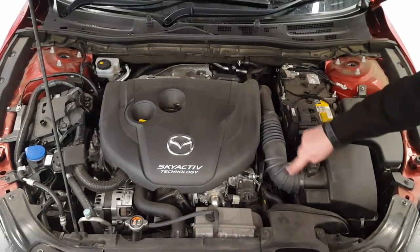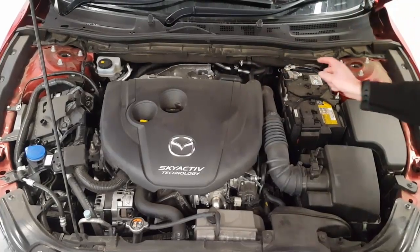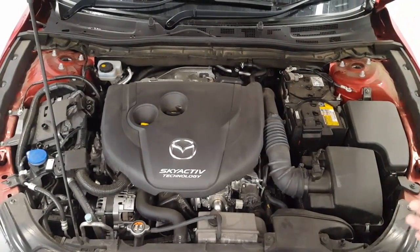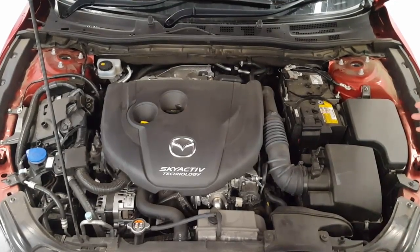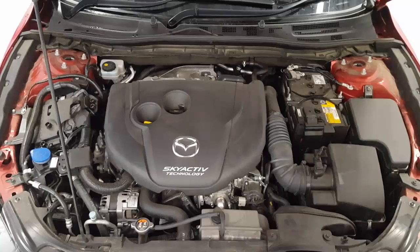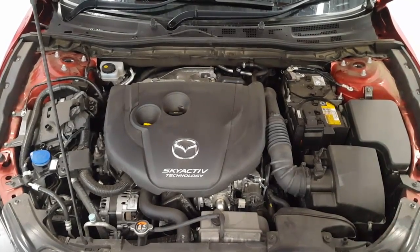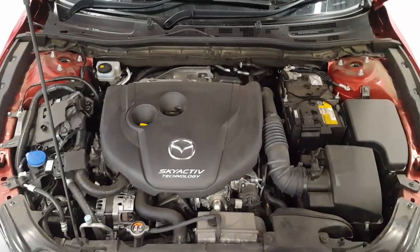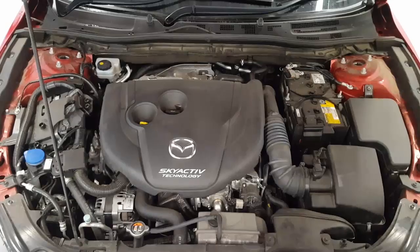This includes the induction system hosing, EGR valves and also, according to the vehicle, central locking systems that use airlines. You've also got airlines now in connection to headlight systems as well as checking turbochargers, exhaust systems, and you can even use the smoke machine to help you identify wind noise and water ingress into the interior of the car.